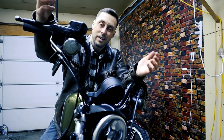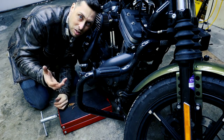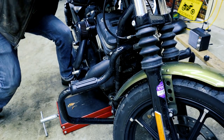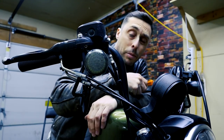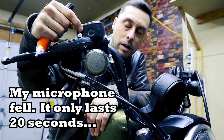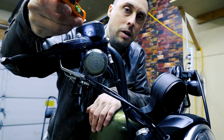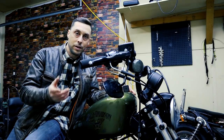To check the front brake fluid sight glass it's a pretty easy process, but you've got to have the bike level. Some viewers have asked where I got this lift — it's just one of the cheap ones from Harbor Freight; they're available on Amazon too and I'll put the link in the description. You don't need the bike lifted, you just need it level with the handlebars level and straight. All it requires is a little light shining into the sight glass. There's a level line inside the master cylinder — you just need the fluid to be above that low mark. If you shine a light in and see it above that line, you're good to go.